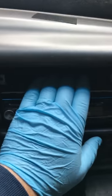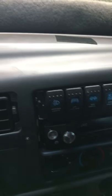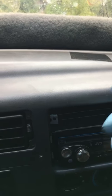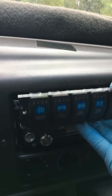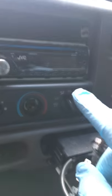I just slide the radio in and then put this up here — it pretty much fits perfect. It's got to be custom though; you have to grind it down. You have to make sure it's fairly level on top and bottom. I did all my measurements between the bottom and the top, and the top of the radio to the top of the dash. It fits perfect this way, but not the other way when you get it. Even if you bought a smaller one, I still don't think it would fit — you'd still have to grind it out.